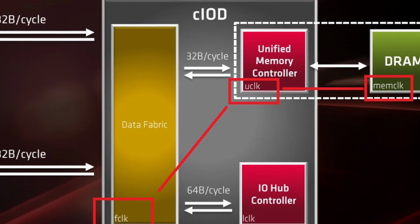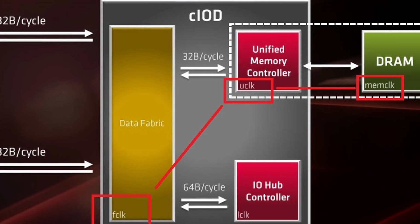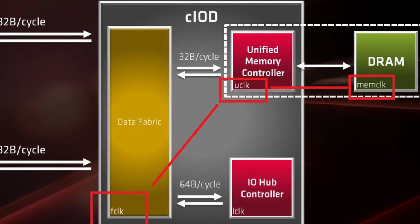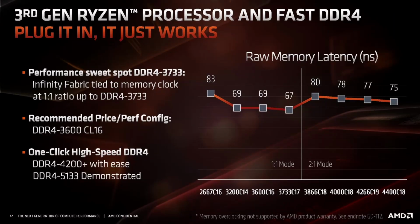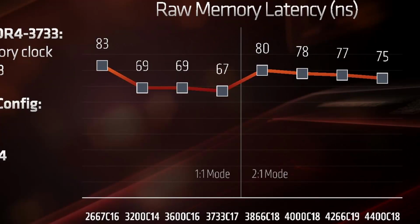Synchronous mode is relatively taxing for the CPU, so on most Ryzen CPUs, the system will automatically enable asynchronous mode beyond a certain memory frequency. In asynchronous mode, the memory controller will operate at half the frequency of the system memory, and the fabric clock will also run below the system memory frequency. This will result in a performance penalty. The size of the performance penalty is application specific and also depends on the final memory frequency. A sufficiently high memory frequency can overcome the performance penalty from running in asynchronous mode.